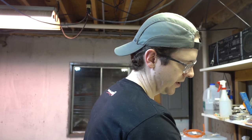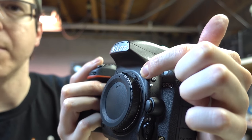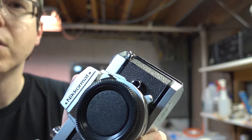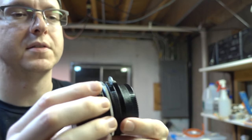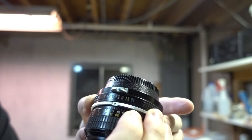The problem is there's a small little tab on the D750 that's used to display the aperture information into the viewfinder when you have a non-CPU contacted lens. Older cameras used a little pin right there that would sit right in the little notch on the lens, and then when the aperture changed, we moved the little tab around.